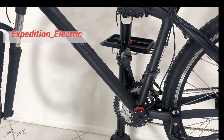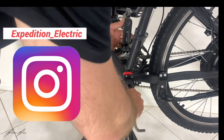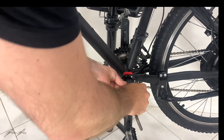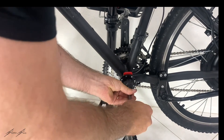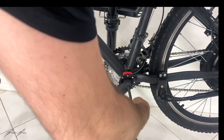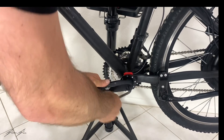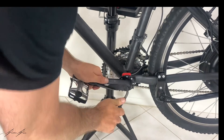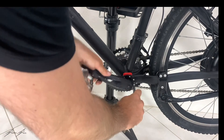Now that that's on there, I'm going to put the crank arm back on. This is going back on this way. Make sure to really tighten it back up — you don't want this loose. I'll put the hex keys that I got in the description below, because if you're working on this part of the bike, you definitely need large hex keys to do it.